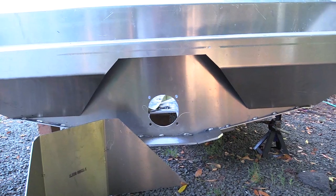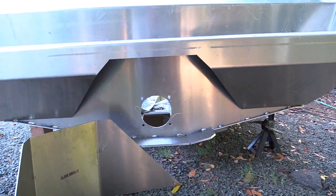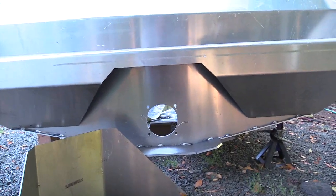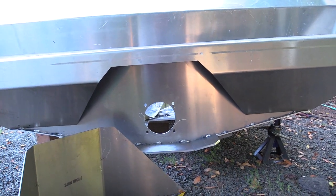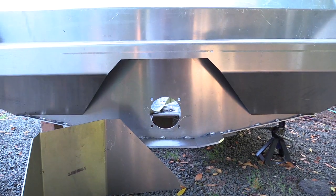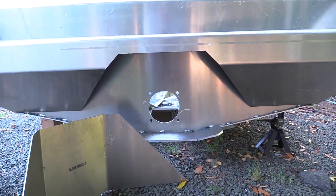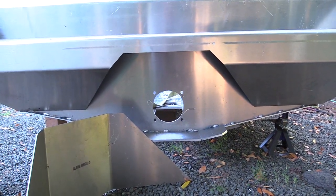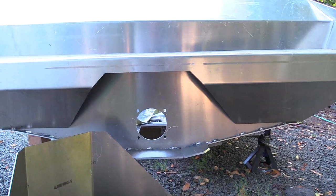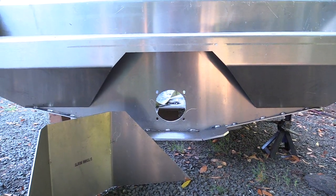The trim control might not have room on the inside — the intake and engine are there, and the exhaust is on that side. That exhaust chamber already has to be shortened just to fit behind the motor, so it's going to be tight. Most likely it'll just be an external box with the wiring going through. I'll have to build a watertight box with a front flanged lip and figure out a secure, reasonably watertight lid. As it heats and cools, an aluminum box in the sun will have pressure — it'll probably have an air relief through the wiring grommet on the inside.